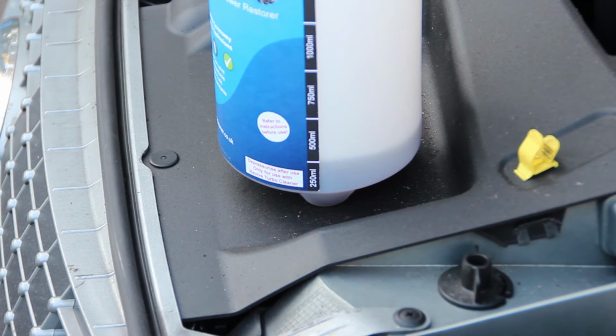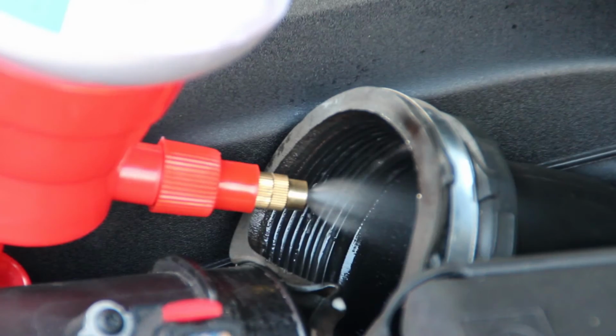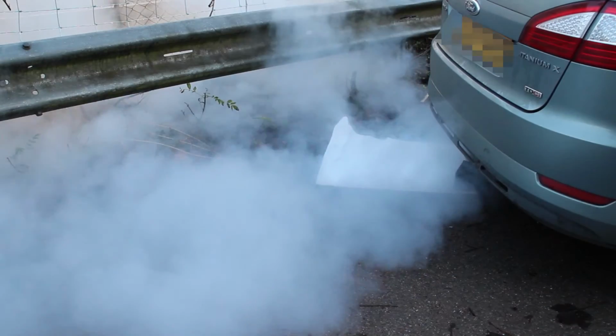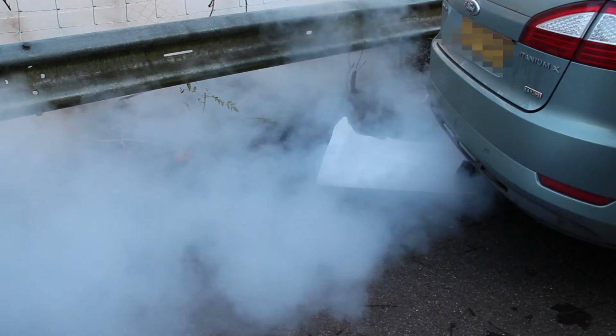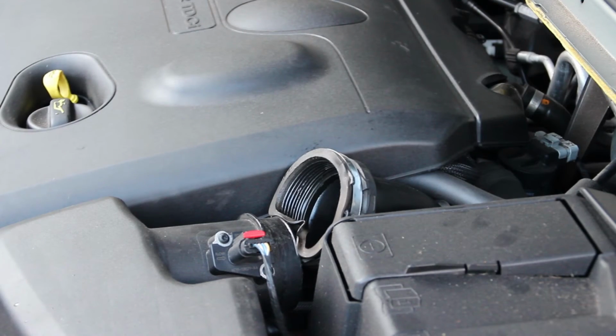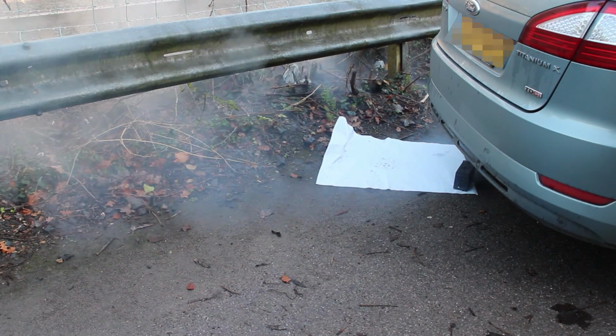While you are waiting, refill the bottle for the last time. After the 3 to 4 minutes, restart the engine and rev to 2000 RPM for the third and final dose. During this last dose, you will start seeing the vaporized fluid from the exhaust. Keep the engine running at around 1800 RPM for a short while after the injection is finished to carry all of the Revive through the engine. The engine should now be left running until the vapour dies down and stops.